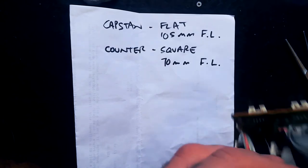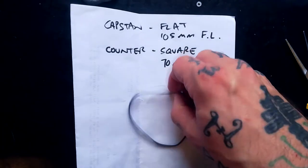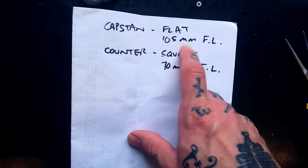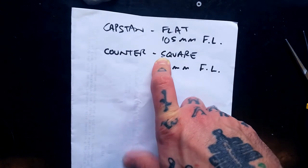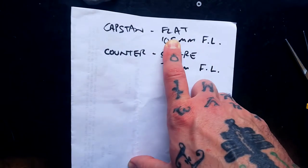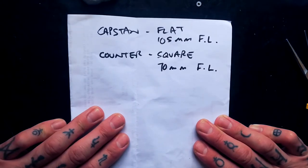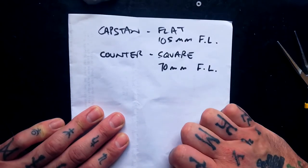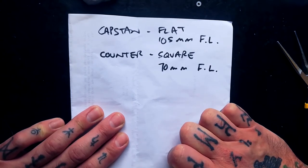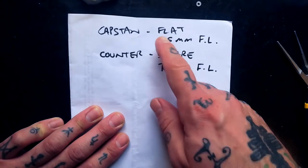The old belts I've put on will be replaced — this one would probably work but it's kind of crusty with a little kink and feels crispy. You really want these to have a good oval shape without any kinks. The capstan belt is flat and 105 millimeters of folded length. The counter belt is square section and 70 millimeters of folded length. I get these from multipacks on eBay. In the UK, flat belts come from gbaudio.com. In the US I'd look at West Coast Belts or Mars. I use folded length rather than circumference or radius because this channel is pitched towards people who don't do much science — though you can get circumference by doubling the folded length.